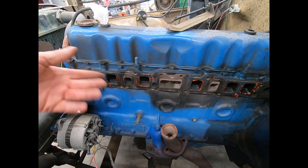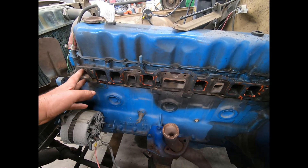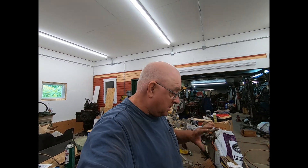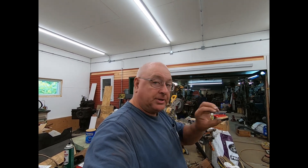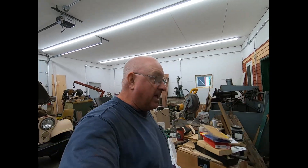The metal one that was in behind fell all apart. I'm not going to use it. I know it seems odd, but the race car guys do it with their manifolds, their headers. That's just like a 3/8ths or 5/16ths piece of steel there that everything's welded onto, and they just bolt it right up with silicone on it. They run cherry red all during the race on them pro stocks and stuff, and they never fail.